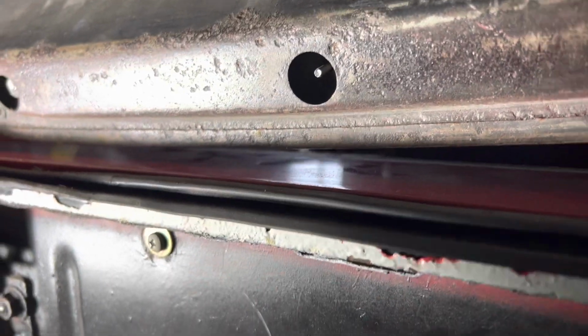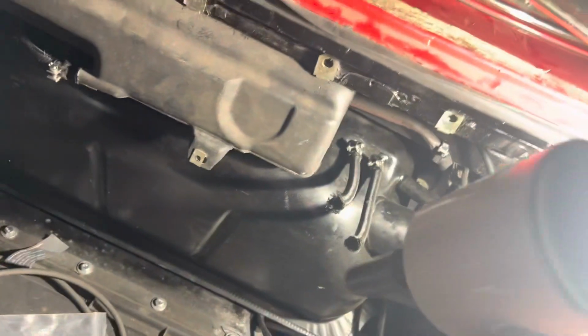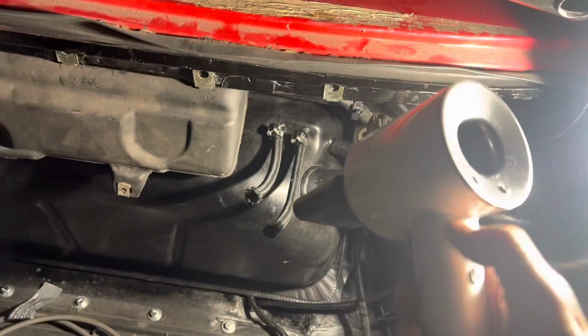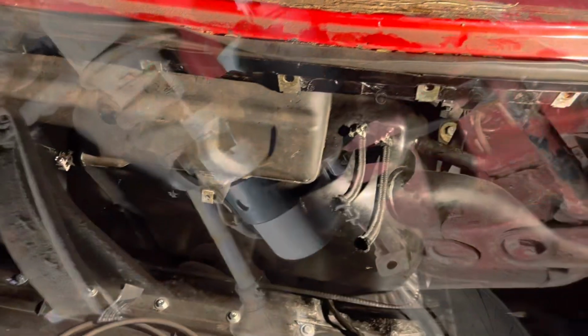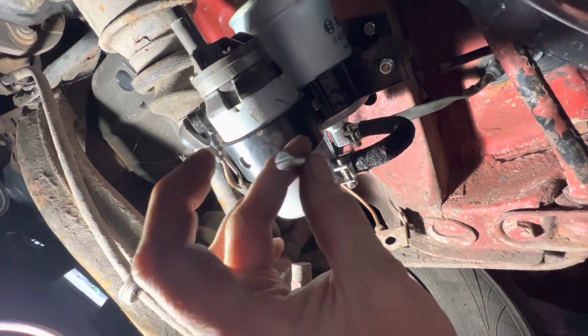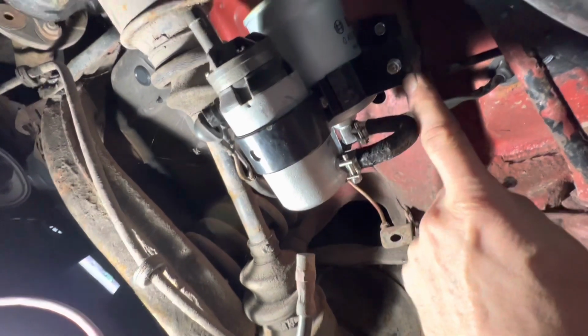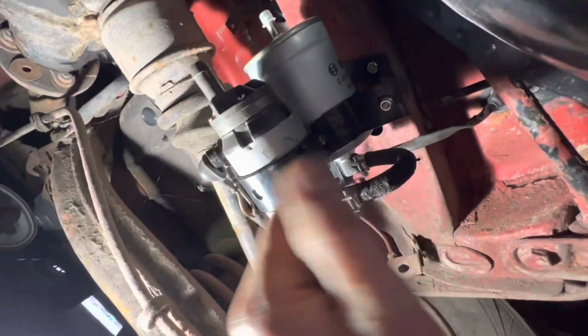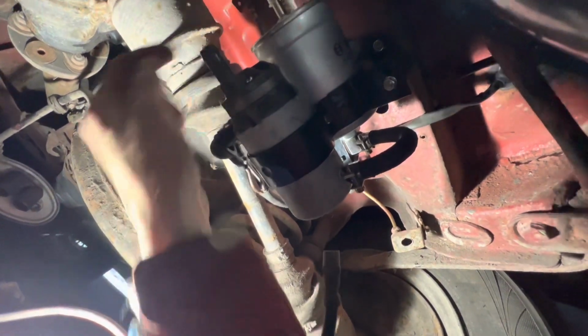That's allowed us to line that hole up, and we can just snap that little thread off now. These pipes are incredibly tight on the little tubes up there, so I'm just heating them with a hairdryer to soften the rubber up a little bit, and that makes it easier to get them on tightly. Now that we've got the tank in, I'm just putting the correct M5 screws and nuts and bolts in here, making sure everything's tightened up. We've got the right cable clips in, and then we'll just connect the fuel hoses and the filter.